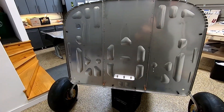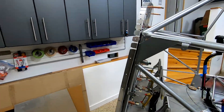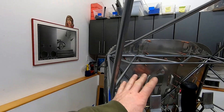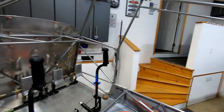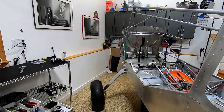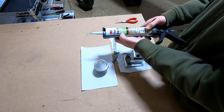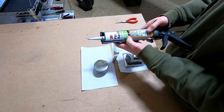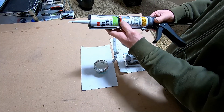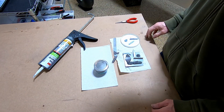I'm going to continue with the firewall. We got some sealant in — we left that off because we wanted to seal it with something. We also got some insulation. The sealant we opted for was the 3M Fire Barrier 2000+ fire stop. It's designed for construction, and there's not a whole bunch of information about whether you can glue it to aluminum, or if it's fuel-proof or solvent-proof.